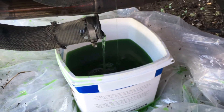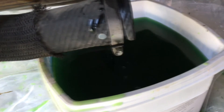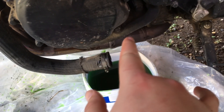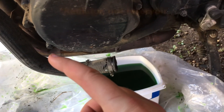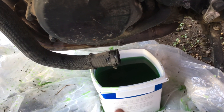Now I can start to hear it. Okay — it's still green, so just keep flushing. Now what I'll be doing is reconnecting the hose and cinching it down so that you've got a closed circuit. Then I'll be topping up the reservoir with more of my 50/50 mix of vinegar and distilled water, and flush that down into the bucket.